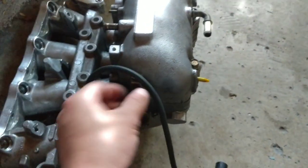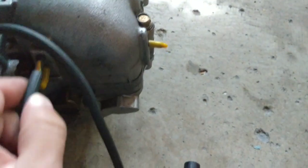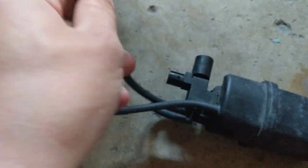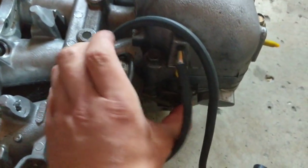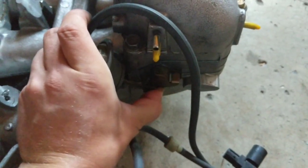Quick update — I did figure out which way this went. This is pulling off plenum vacuum. This is just a simple vacuum port with the one-way valve in it — that's what keeps air into this reservoir. Then you have the output which is electronically controlled; it doesn't have the one-way valve on it. That comes out into the solenoid, which controls your secondary flappers.